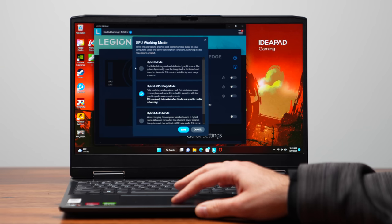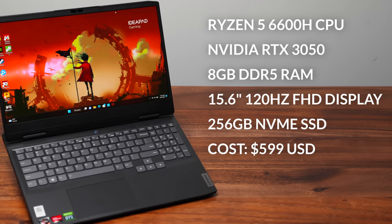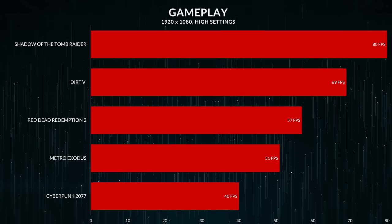This laptop has the ability to turn the dedicated GPU off and only use the iGPU — Optimus. But the problem is it doesn't have a proper MUX switch where you can turn off the iGPU and only use the dedicated GPU. In terms of performance, it's a very budget laptop — a Ryzen 5 6600H with 8GB of RAM, a paltry 256GB NVMe SSD, and an RTX 3050 with a total TDP of 85 watts. For gaming, you're not playing the newest titles with settings maxed out; most new games you'll have to drop to medium settings, but anything older will be just fine on this RTX 3050.